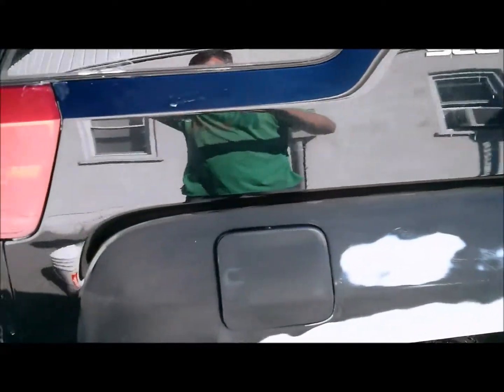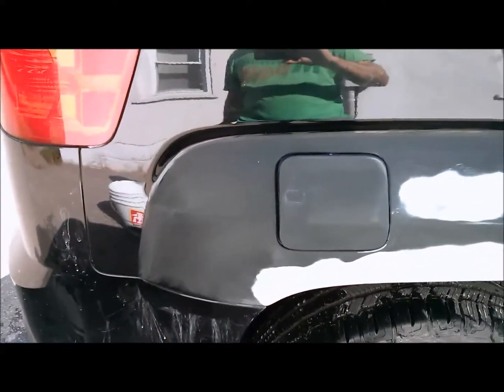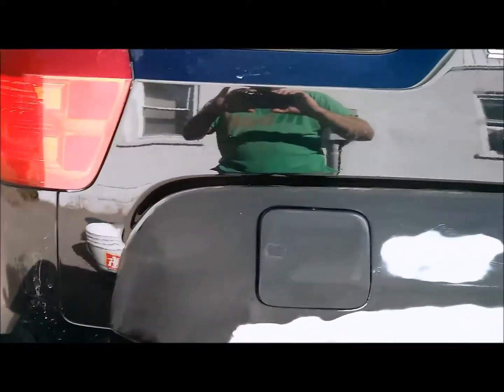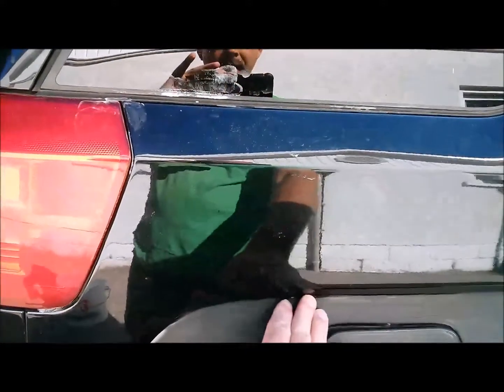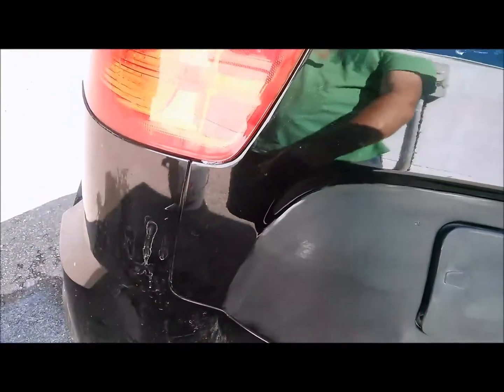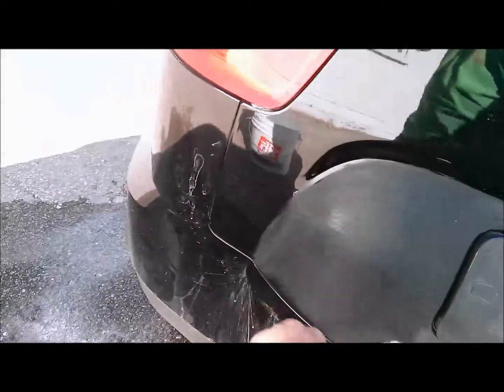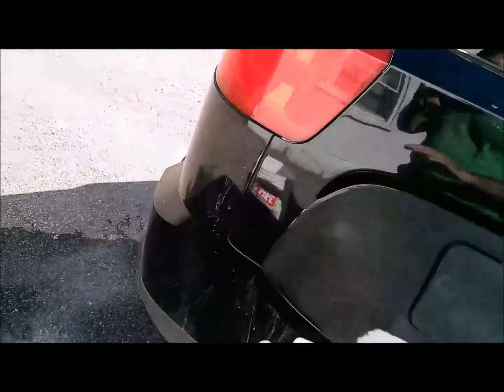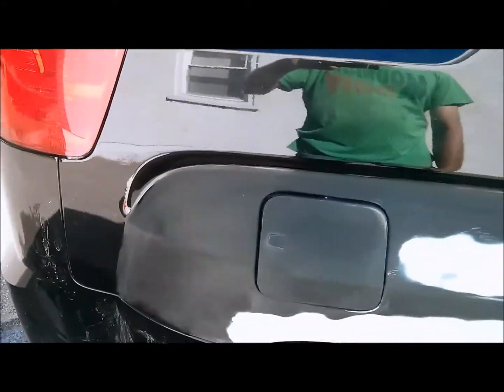Okay, I got sanding all done, ready to tape this in. I'm doing a folded over edge tape line around where the scuff marks stop along the edge here. I'm going to do a piece of fine line tape, followed by a strip of regular tape around that, and on the inside a piece of folded over tape to make a false edge around this line so the clear's got somewhere to go. Then peel that off, spray a little bit of thinners around, hopefully get that edge to bite in.